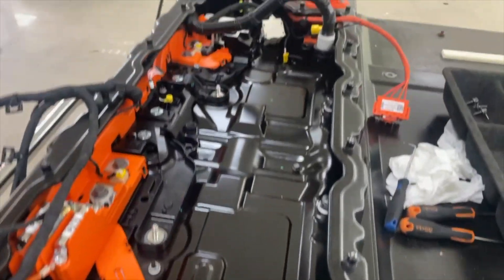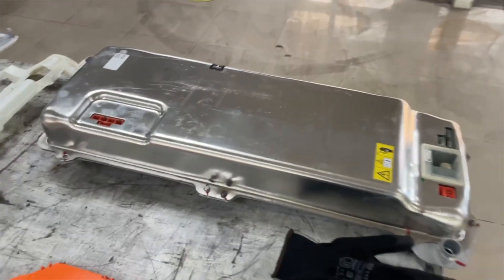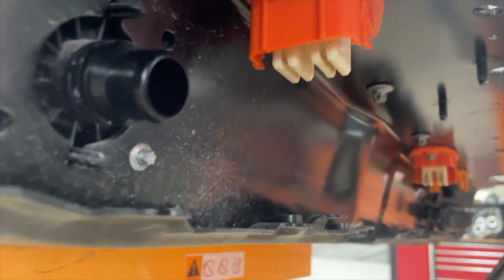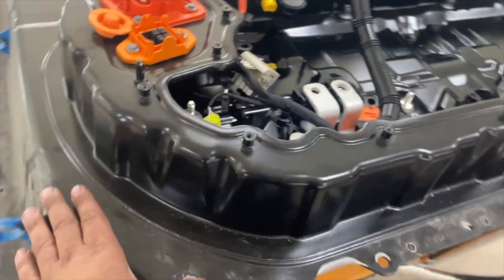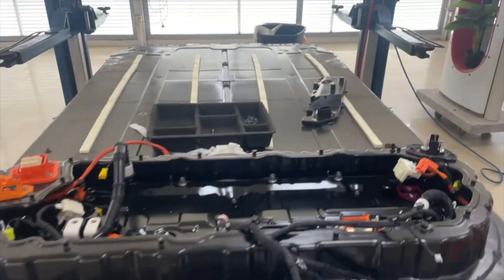The penthouse is out and almost completely disassembled. Those are all the parts: OBC, power distribution unit, contactors, AC contactors. The most difficult part is disassembling the high voltage connectors. First you need to detach the HV side, then we will be able to lift the complete core, because the core is one complete part from the upper side.